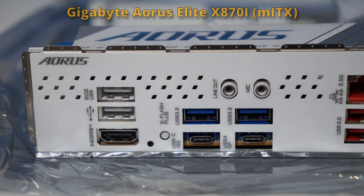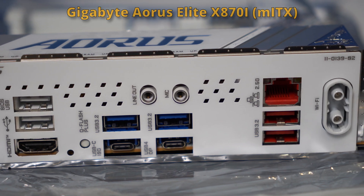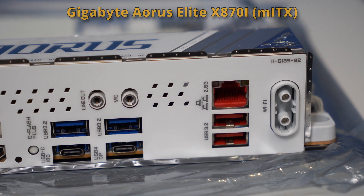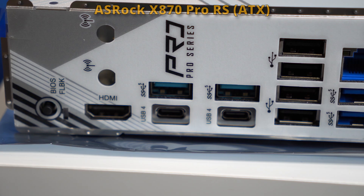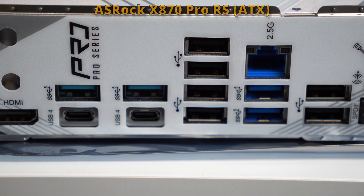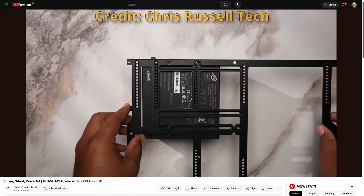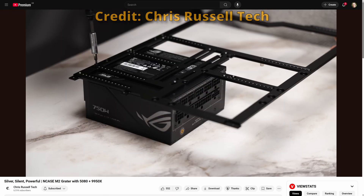The IO offered on a Mini-ITX motherboard might not be as good as Micro-ATX or ATX options — you're probably going to get less USB support and things like that. When compared to an ATX motherboard, you can see there's a significant difference in connectivity, and it makes sense because the motherboard is physically smaller. Building in a Mini-ITX case in general is more complicated — sometimes you need to actually build the case around your computer build, which some people enjoy, but can also be quite difficult.